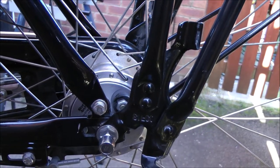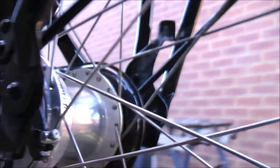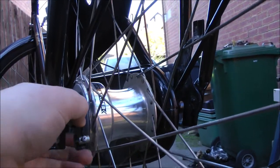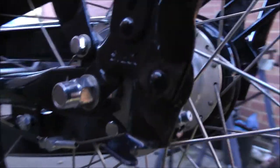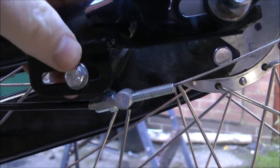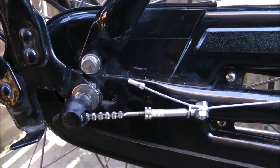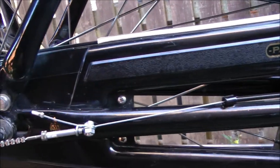The first thing I've done is wind back the adjuster to give me enough room. I need to push that lever in and move that to the side — not easy with one hand. So that needs to come off there, this anchor bolt for the brake needs removing, I'll need to undo the gears, remove the chain guide, which is a matter of four screws — it all comes apart quite easily.